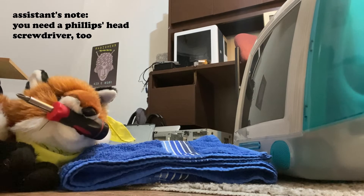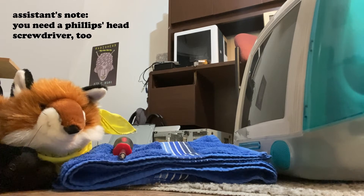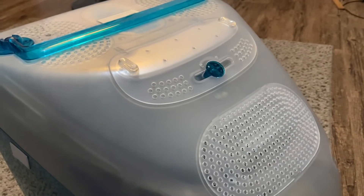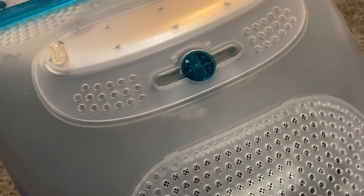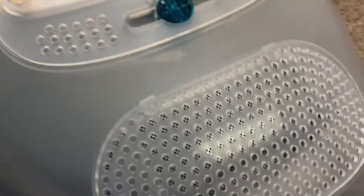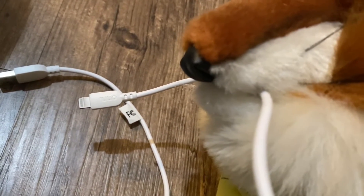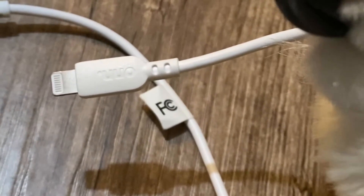The screen is pretty fragile, and this case is arranged in such a way that you can put a lot of weight on the screen that isn't supposed to be there. So once the machine is either facing down or on its back, you'll notice there is a little tray — this is how you would typically get to the RAM or replace the PRAM battery. You can get this open with a standard screwdriver, or what I like to do is use a Lightning phone adapter, which goes right into the little key and opens it right up.